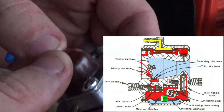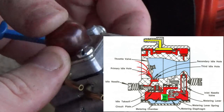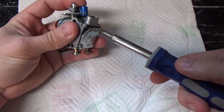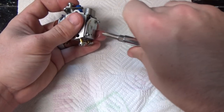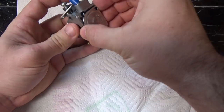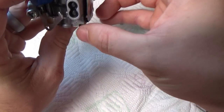So the only two areas of the carburetor we can actually clean are this fuel metering diaphragm and the primer pump you see me pushing there. So let's go ahead and get this carburetor taken apart. The first thing we're gonna do is take off the housing to the fuel metering diaphragm. I'm going to be really careful when I take it off not to tear it, to keep that gasket intact.